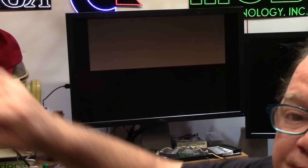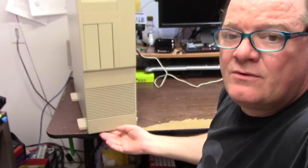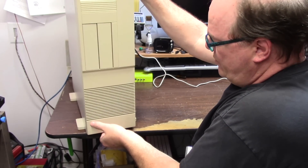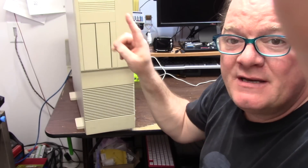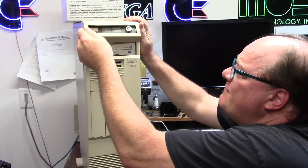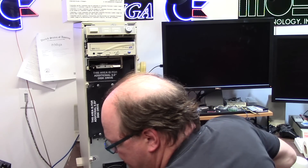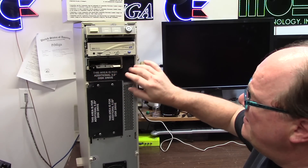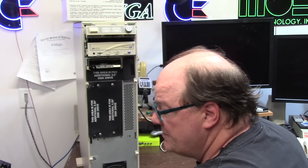Now I have to shut this down and take it all apart. To remove the Amiga 3000 Tower side panel there's a little pushy tab at the bottom. I give it a tap because there are two tabs up top that hold it together, and I'm so careful with them because if they snap off you've got to do the old ESOL — I did the crazy glue with cyanoacrylate and baking soda which makes instant concrete.